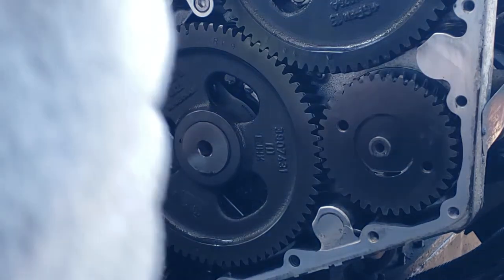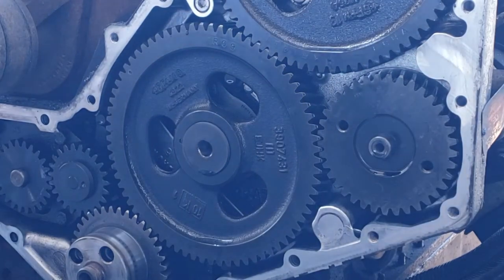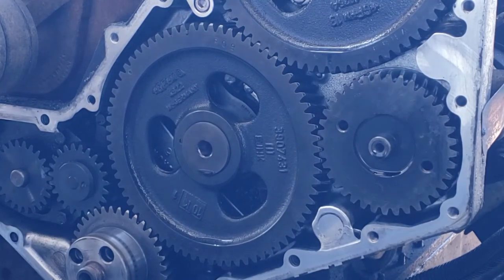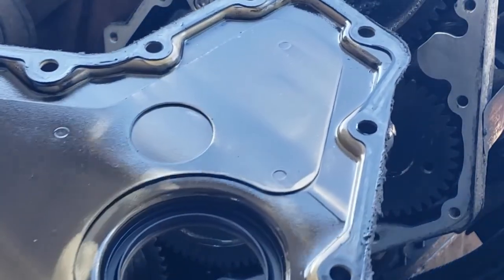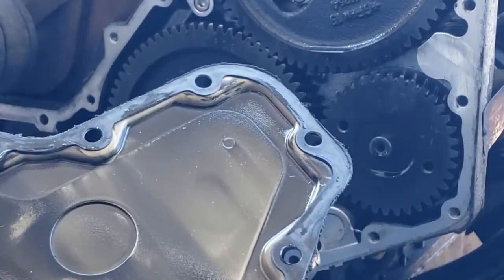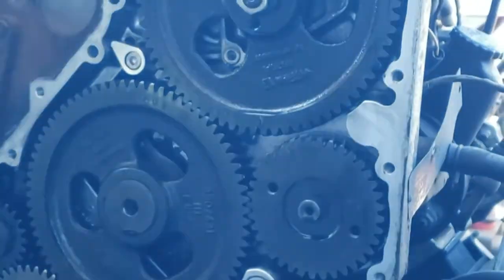All right, so there's our seal. What I'm going to do — I've got to clean up the back of this pan, get this gasket off, get that all cleaned up, and I'll come back when I'm getting ready to drive that in. It's not a concern that you leave fuzzies here — this paper towel is not going to hurt this engine but it could plug an oil filter. That's clean. I should make sure that it's clean.